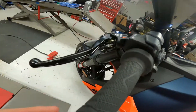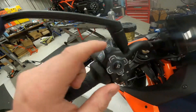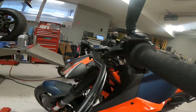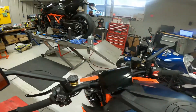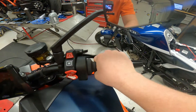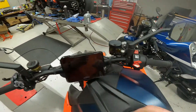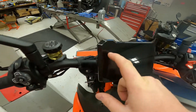Basically you're going to hold three buttons for three seconds. It's this one, this one, and the one on the back — not at the same time, one at a time. Hold them for three seconds each. Then you're going to take the throttle and just roll it forward just a little bit — it goes forward and bottoms out. That should reset your cruise control light to stop flashing.